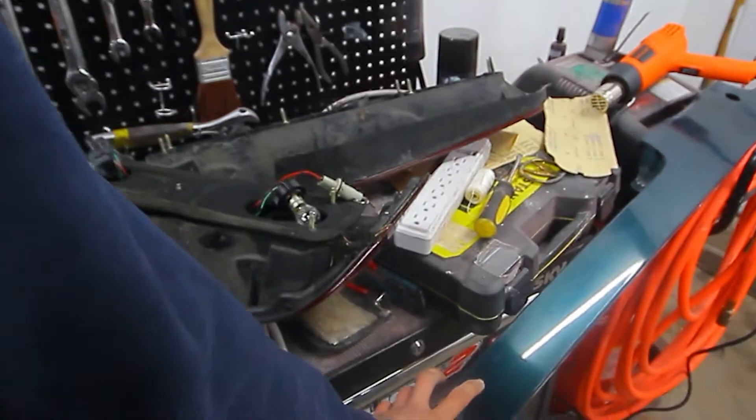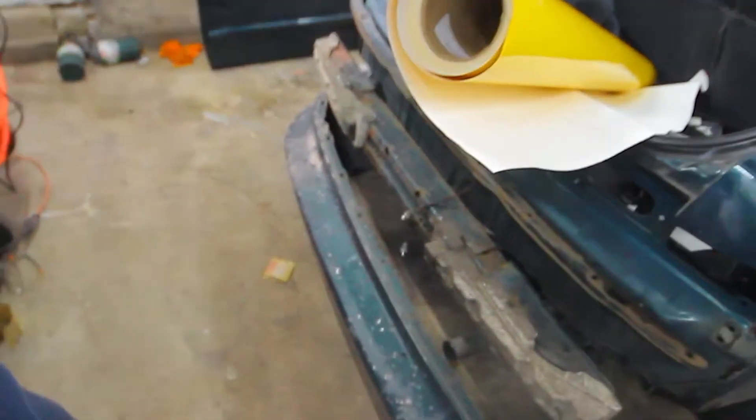Check this out — this is the wrap that's going on. Been prepping it a lot — a lot of sanding and wet sanding. Had to take out the tail light, the little middle piece, and the bumper — we're throwing the old one away, we got a new upgraded one, the '98 to '01 bumper. I already wrapped the rear bumper but it's shitty and I have to redo it, because the key point on wrapping bumpers is it has to be on the car. I did it while it was off the car and I was fighting with it, and it just didn't turn out well.